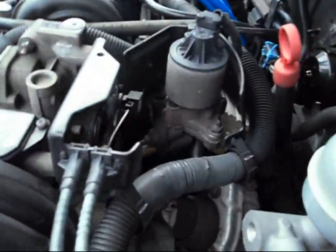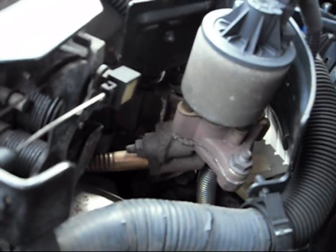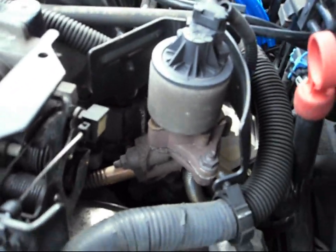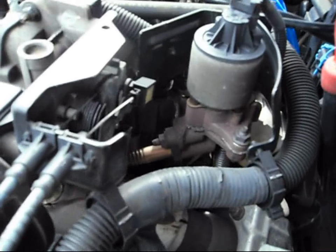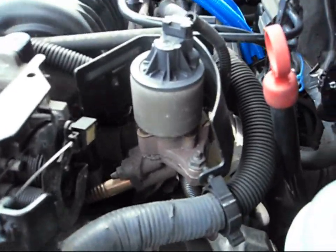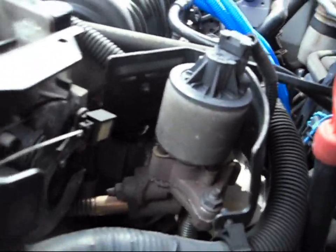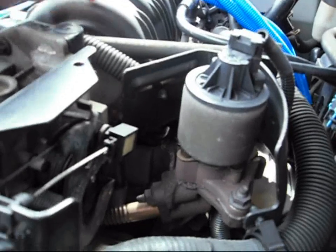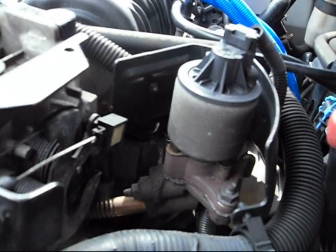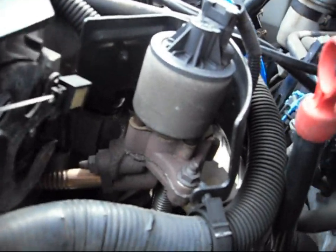I was trying to find where my oil leak was coming from. It looks like it's coming from right there — you can kind of see it's a little shiny in there. I cleaned the engine as good as I humanly could to see if and where anything is leaking so I'd be able to find any fresh leaks. Yeah, it looks like it's coming from the upper plenum gasket — a little oil leak — and it looks like it's working its way down to the hot exhaust.